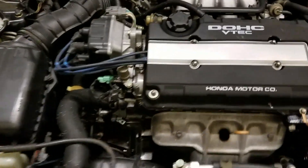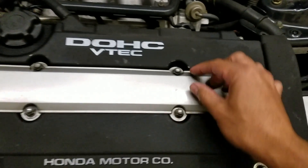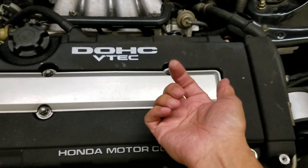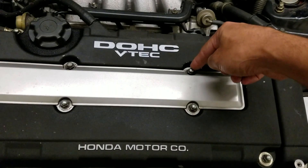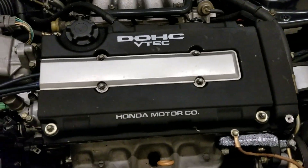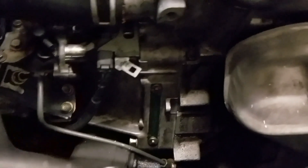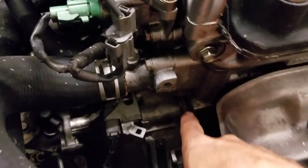Today I'm going to be doing one of two things: taking off this cover right here. That's not going to be easy because this acorn nut seized through the stud - it's just spinning. I have to keep spinning it, pull out the whole stud, then separate the stud. I'm also going to take off the distributor and check for leaks. I have a real bad leak right here as you guys saw in the previous video, and fortunately it's above the head gasket, so it's one of these seals that's leaking.